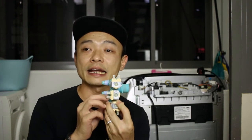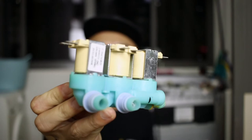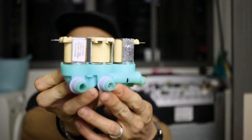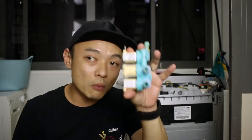If all those are okay, your issue will be the solenoid water valve. I've taken the washing machine apart to find the part number so I can order a new one. This is the solenoid water valve — it looks something like this. It connects all the electrical points, the water hose goes into the valve, and it injects the water into the washing machine. I've taken note of the model number and went to Lazada to purchase one. Depending on the brand, the part number is different.